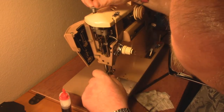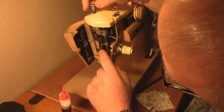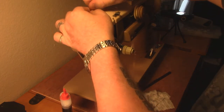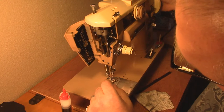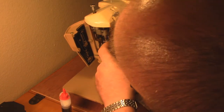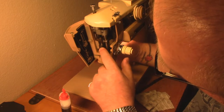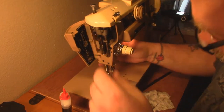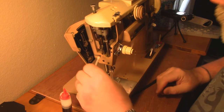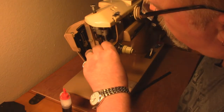The next part to clean up is the hold-down. I'm going to back it all the way off to get as much of that shaft up as I can so we can clean off all the crud - it is just covered. We're also going to get the pivot for the camshaft, the riser up and down, and the hold-down dogs - clean all that up and get it really shiny. Right now I'm just going through here pulling out all the debris, and there is debris in there. It's astonishing how much debris gets inside my sewing machine.